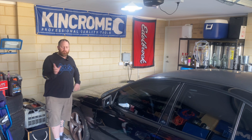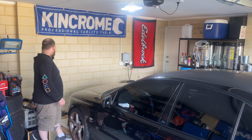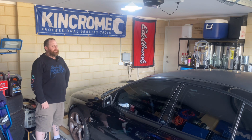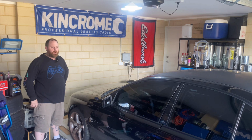The wagon, when we got the rack back in, it all went well. There was a couple of hiccups along the way. Closer inspection of the previous rack had a helicoil into the high pressure line spot. So, and a lot of the O-ring was very, very squashed and very, very damaged.